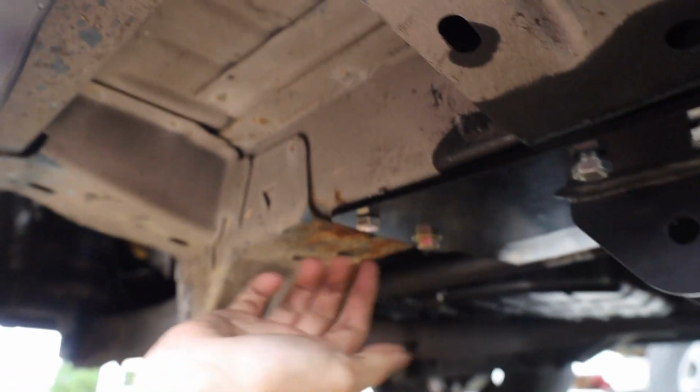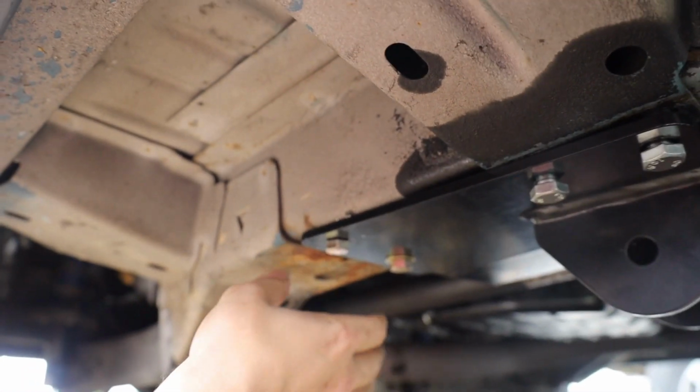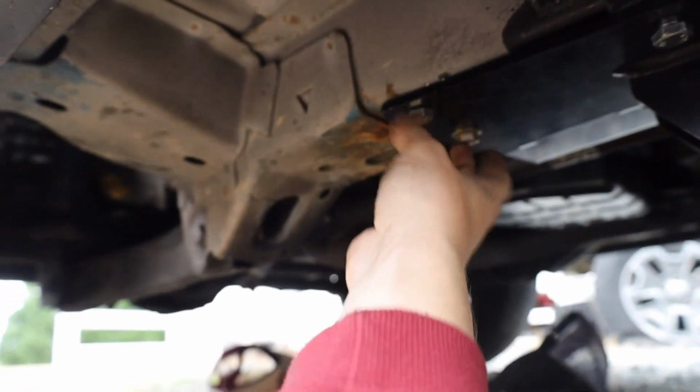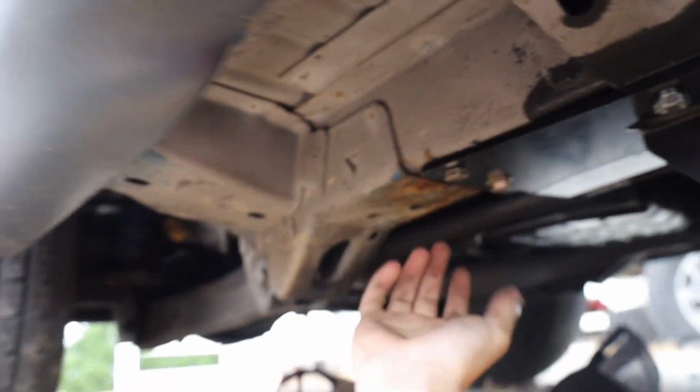One thing I would recommend is, once you get the bracket bolted up there, stick the drill back through and kind of clean out that hole. Get it to the exact right size. That'll make this a lot easier. What I found to work best with this nut plate, threading it up, was to put it up through the hole right in front of the bracket and then push it out with your finger or a screwdriver.